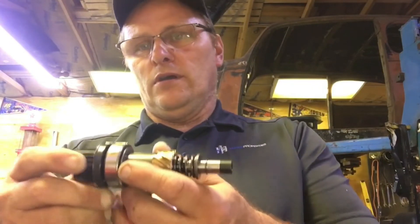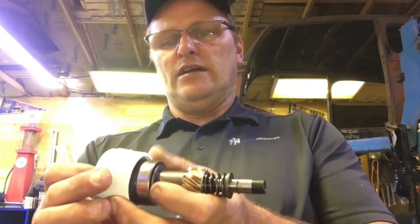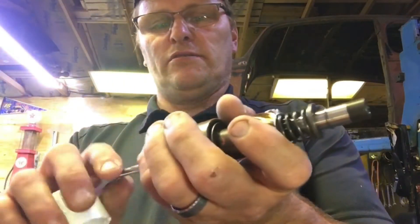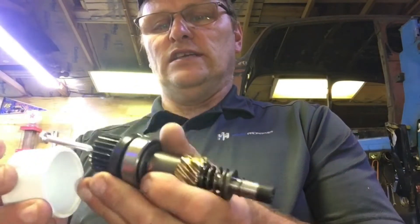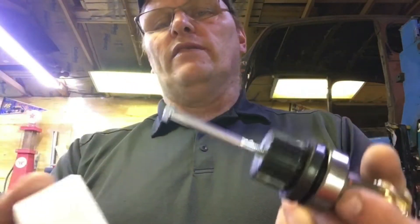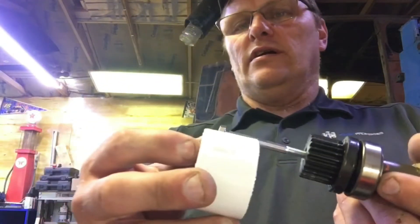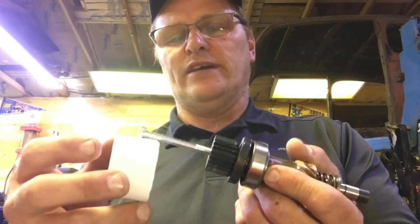But you have to pull this out of the side of the case. To do that, we're gonna make a little makeshift puller. This PVC will rest against the side of the block. We'll drill a hole in the end of this, run our screw through here — this screw threads into the end of the shaft. As this bolt pulls through and the PVC rests against the case, it's gonna pull that loose. I think we've got less than three dollars in this puller. I'll throw it in my specialty tool drawer with all the other things we've made for different projects.